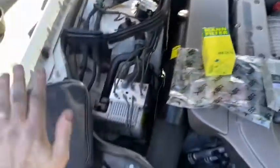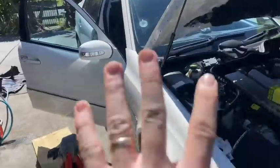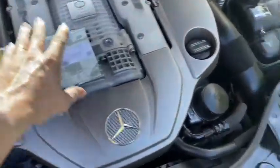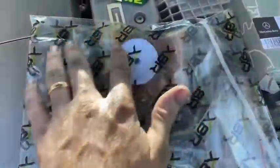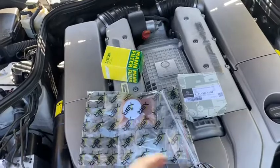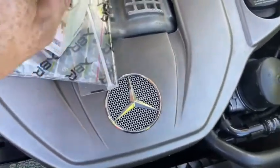We're going to use my Foxwell OBD scanner tool to let the compression out of the airmatic system so there's no pressure in it, then we're going to get into pulling out the compressor. I'm not replacing the compressor — I'm just simply servicing it with this little kit I bought on eBay. There's some filter media, new bolts, a new little piston ring, because the piston rings can wear out on the compressor, which means they run longer and don't give enough air supply to the airmatic system. And then I've got a brand new valve block that I bought off eBay, because they're horrendously expensive here in New Zealand.